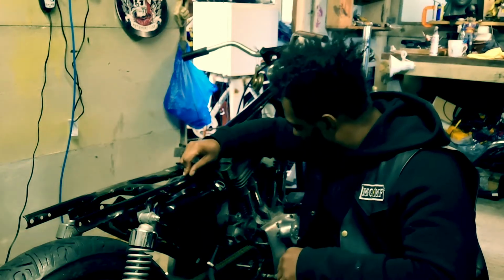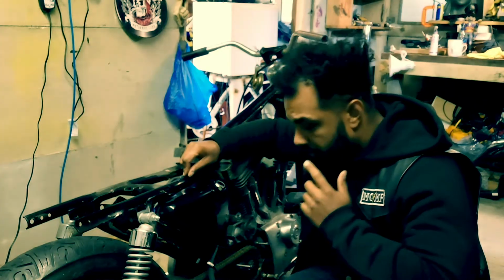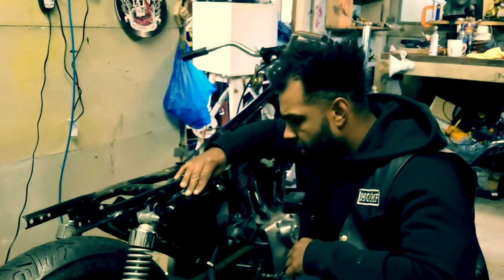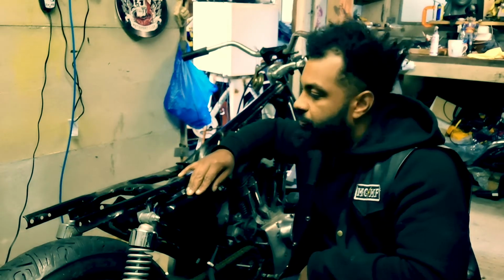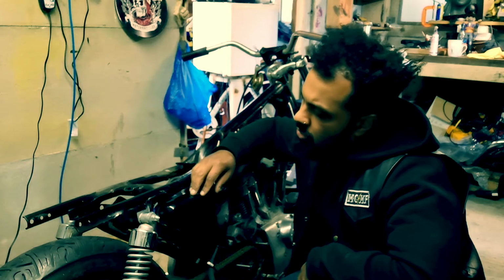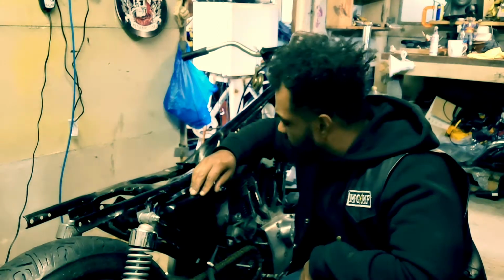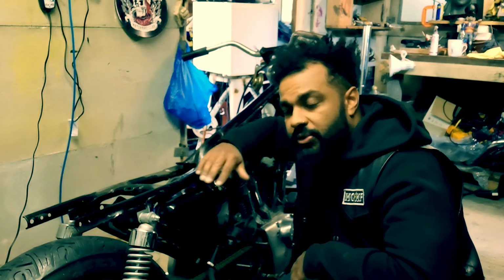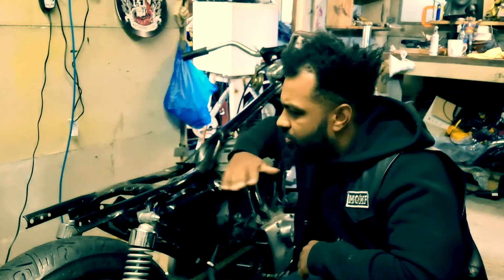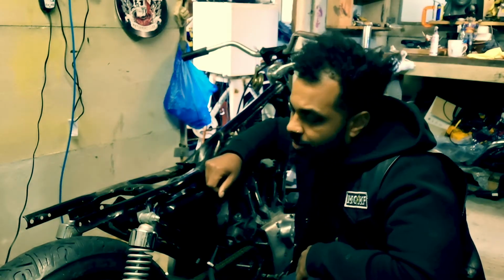But there's a few issues with this bike. One of the issues being that there's a big pool of oil I keep finding. I filled up the oil tank and I keep finding a pool of oil near the front, so I'm not too sure whether we've got a gasket gone or whether it's something really easily fixed, like a tube which isn't on properly, or did I put too much oil in, or it's what I think they call wet sumping, where oil is sitting on the bottom and it's coming through but it hasn't been used for a long time. I don't know, there's loads of stuff.